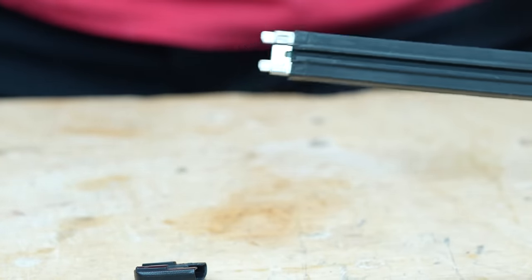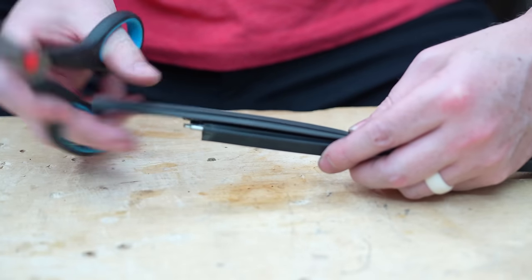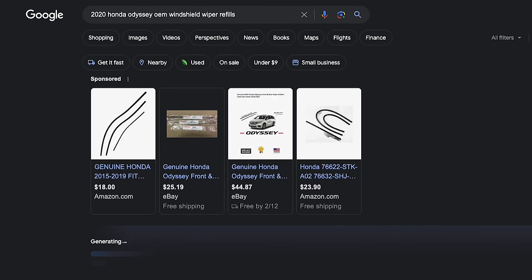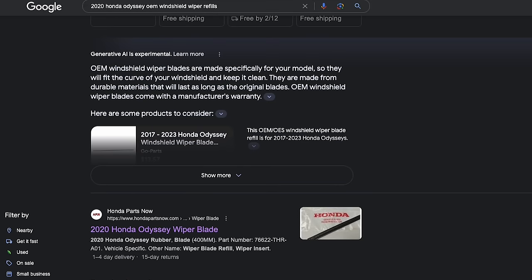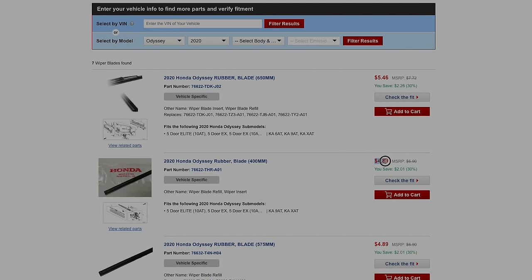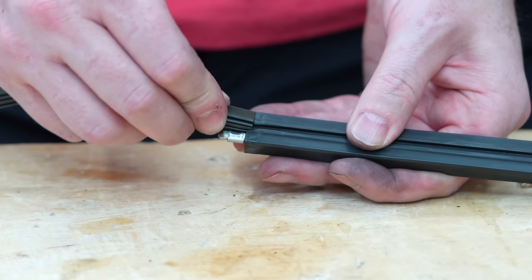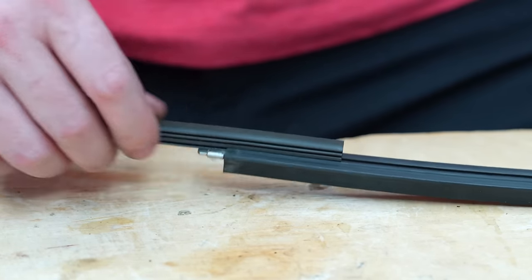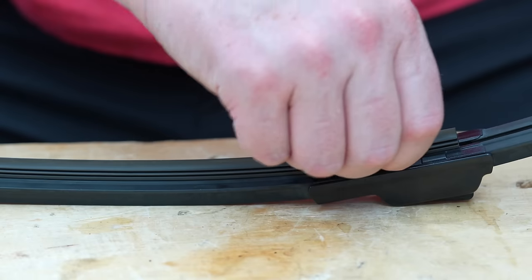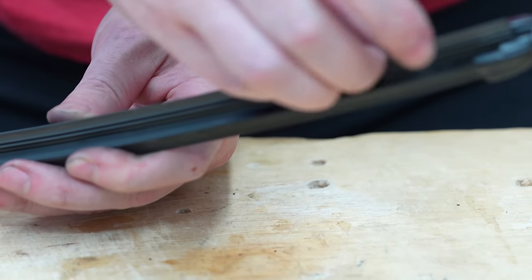You can do a quick search to find what length blades you need for your year, make, and model, or just buy the 28-inch ones — you can cut these with a pair of scissors and trim to length. If you want the OEM version, just search, for example, 'Honda 2004 Civic original wiper refill' and you're likely to find one. They cost more than third-party ones but still way less than buying new wiper blades. Since I can't make a guided tutorial for every blade type, I'd recommend disassembling carefully and slowly, paying attention to how things were assembled, then reassemble with your new refills. Most of the time it's really easy, and if it doesn't work out, you're only out five bucks.